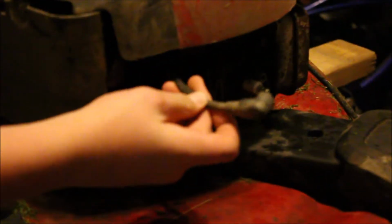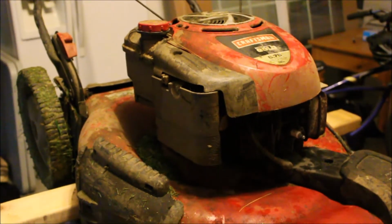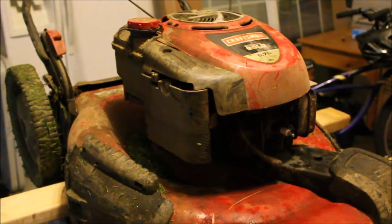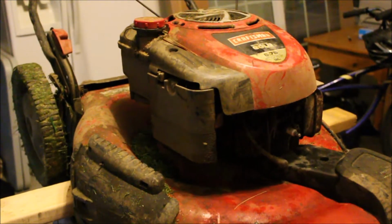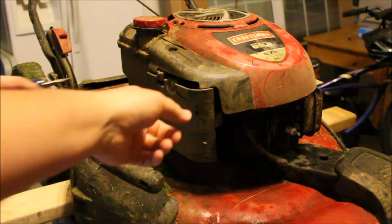Alright guys, I'm going to make this important announcement for you. On these units, we do want to make sure that the spark plug is unplugged. That way you don't have any accidental misfires. So first we've unplugged that spark plug. Now our carburetor is in this chamber. So Alex, you're going to need a flathead screwdriver to take off this compartment. So go ahead and take this out.